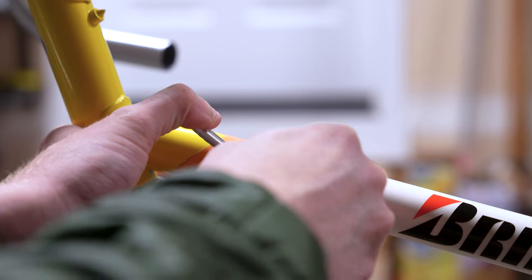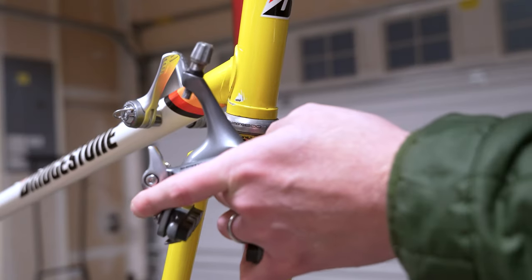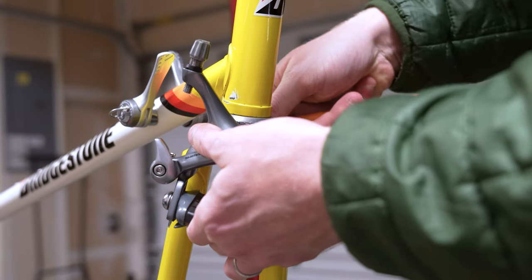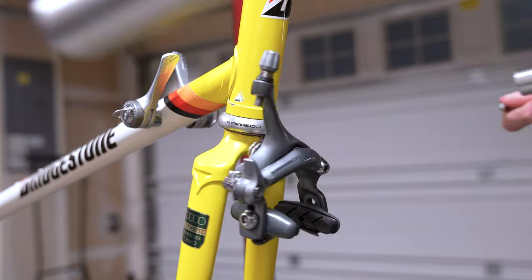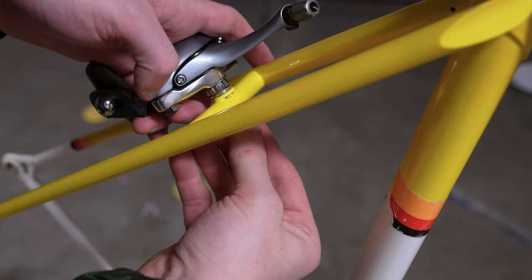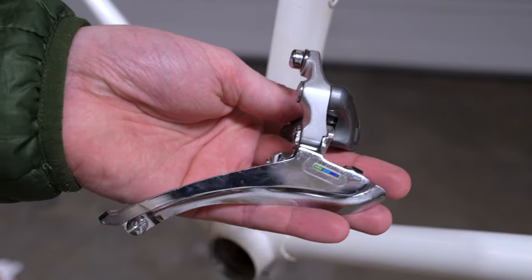For those not too familiar with friction shifting, the front shifting is kind of nice because it actually has a spring in there as well. When you're shifting up to the larger chainring, the spring actually helps you out — it's called Shimano Light Action. It is very light action; it takes very little hand force to actuate these downtube shifters. It's a really nice system.